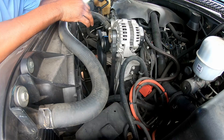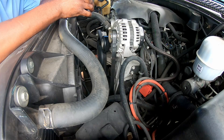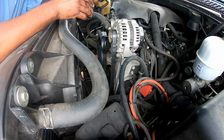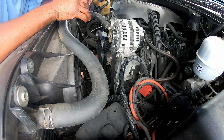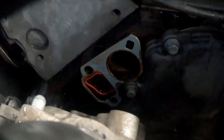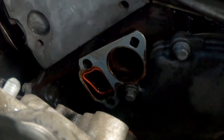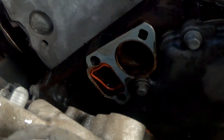I tightened up the bolts — well, the bolts were already tight. I have a leak on the side of the water pump. I have some gaskets already, and I guess since I'm already here I need to get it fixed because it's leaking and I don't want to damage the engine. I want to give everyone a close-up on why the water pump gasket failed. You can see how the gasket came apart — the O-ring part separated from the gasket itself. That's why it was leaking on that side.